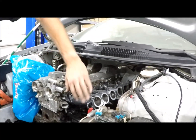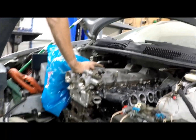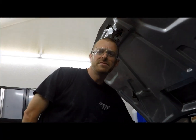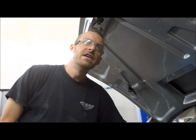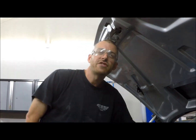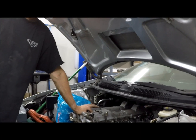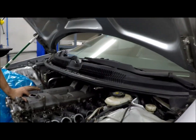And then the front of this, it'll end up with a front-facing throttle body right around here. And this will get a General Motors, easy for me to say, gold blade throttle body. It's a 90mm throttle body, drive-by-wire, which is really a steal of a price, like $100 brand new. Yeah, compared to doing something Toyota branded on this, it would be a lot more expensive.